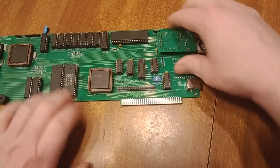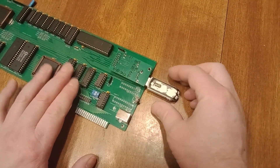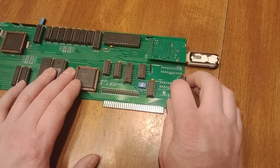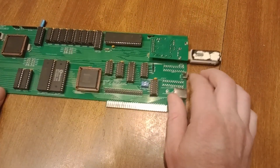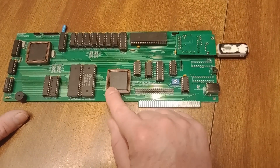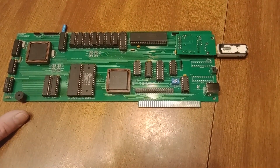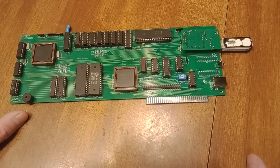It boots from the USB here — this is my USB module. The other factory module will fit, but this one is measured up for this. It is to reduce cost, but it's kind of an isolated system. The only thing you can do is view the memory and send scan codes — that's it. You can't send anything else through the ISA bus at this time.